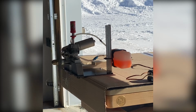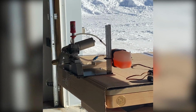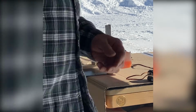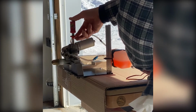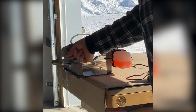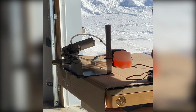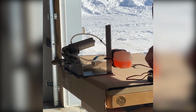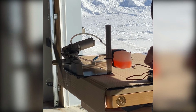Again, we're just going to make sure the engine is warmed up by running at higher RPM, and then we can reduce the RPM with the carb and check the idle, check the transition. The more the engine accumulates runtime, the smoother this will get. And also, if you lean out the bottom end in very small increments, you usually won't overshoot and get too lean. Just leaning out the bottom end slightly again.